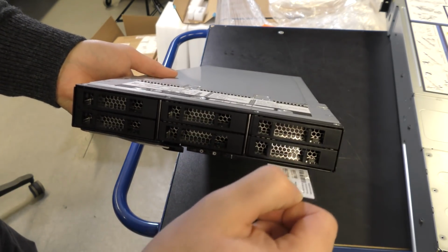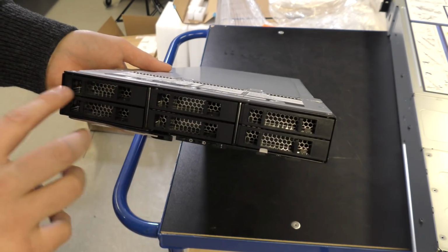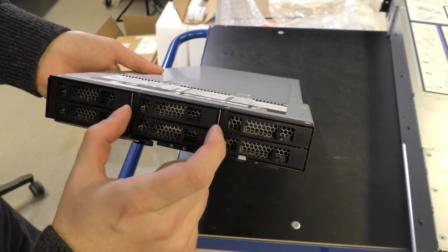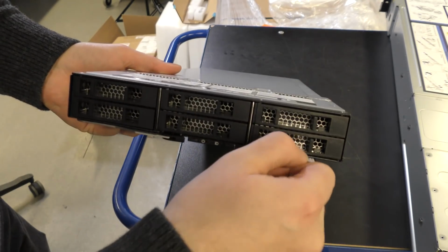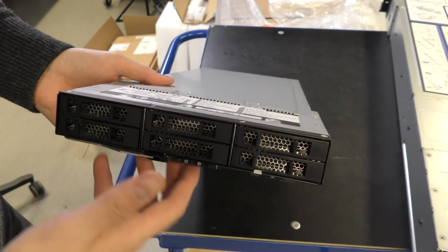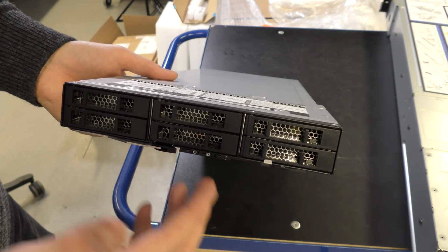Then there is a flipper here to pull out and have all of your important data sitting there, because there is so little space in front of the server here that putting a label over that, well, it really removes a lot of the airflow of this server if you do that. So use the little flipper instead. It's irritating that you can't see what the name of the server is, but you might not need that if you just get the right amount of air through it.